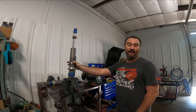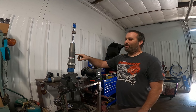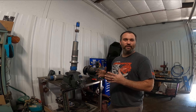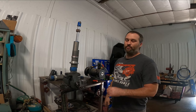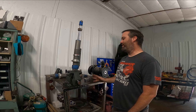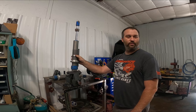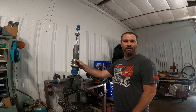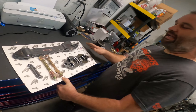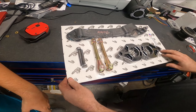The previous owner of our car didn't have limiting straps but had all the shock work done. I took them apart and rebuilt them. Upon rebuilding them, I noticed the internals actually had impact points — you could see where the shock had impacted inside. They never pulled through, but we replaced the internals completely. I replaced the shaft on my own car, replaced almost everything except for the actual body itself. We put the limiting straps on, ran it for two years, then pulled apart the internals just to do O-rings and general maintenance — and everything looked beautiful. As a Shock Therapy registered dealer, I can get all this stuff for you; you don't have to worry about shipping or getting the wrong sizes.